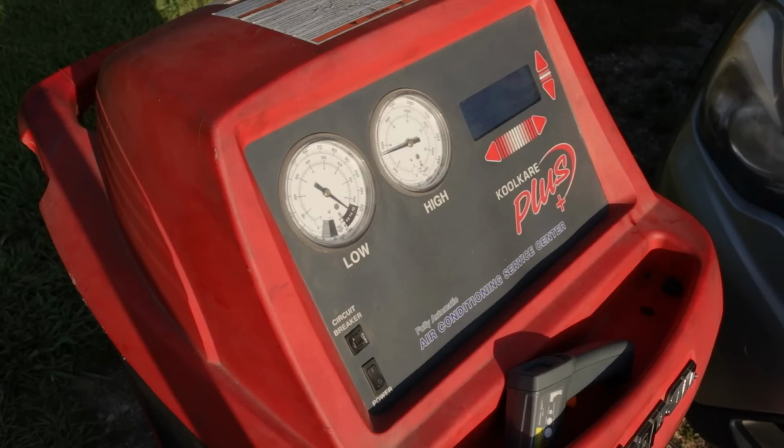Once the needle on the gauges moves, you know your valve is open. You don't need to open these all the way. If you crank down on these thumb screws all the way till they stop turning, you do have the possibility to bend or damage the Schrader valves. They only have so much movement up and down. So you only want to move them to the point where they open and you see the pressure rise or change on the gauges.